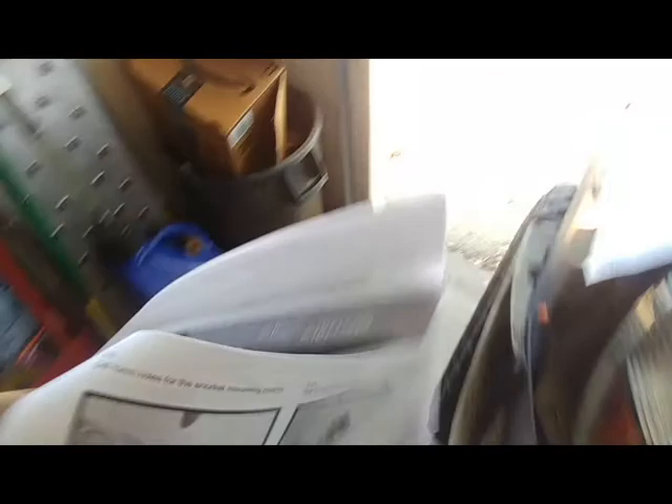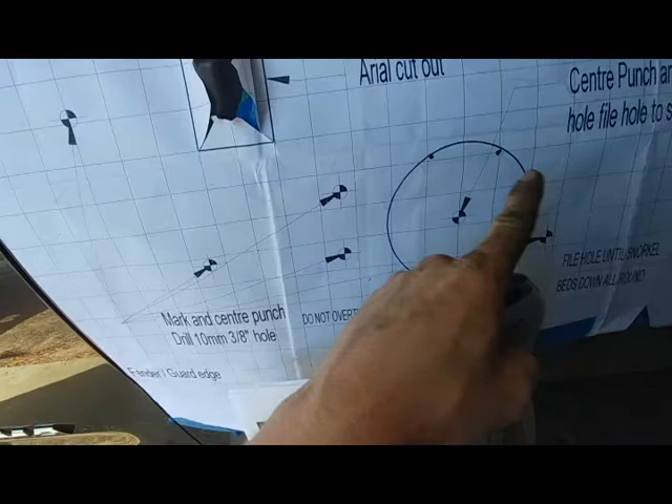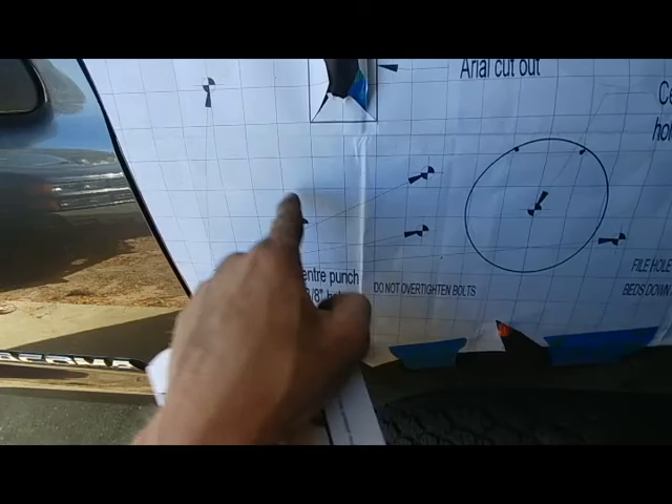Once this hole is there I'll be able to mount it flush against there. A lot of people say take the studs, put them into the body of the snorkel, and put a little bit of grease or paint pen on the tip of them — anything, yellow, doesn't matter. Then just push it up against there and get it where you like it. As soon as it touches, it'll leave an imprint on where the dot is actually supposed to be. So if you don't think these are going to be correct, you can just go off of your own dots. I'm going to drill a big hole in the side of my truck — send it.